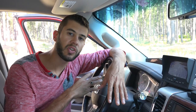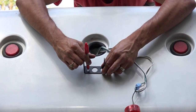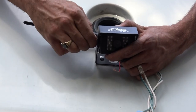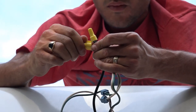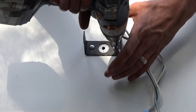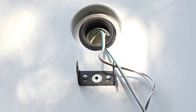I chose to wire the camera into the running lights on our RV so that I could just turn the running lights on from the truck without adding any other switches or power sources to the back of the RV. We had running lights on the top of our RV in the back, so I popped one of those out, pulled the wires for the camera through a drilled hole where we were going to mount it, and spliced it directly into the running lights. There were no screws included, but we used some basic screws and screwed the bracket into the back of the RV right over where the wire goes, then mounted the camera on there.